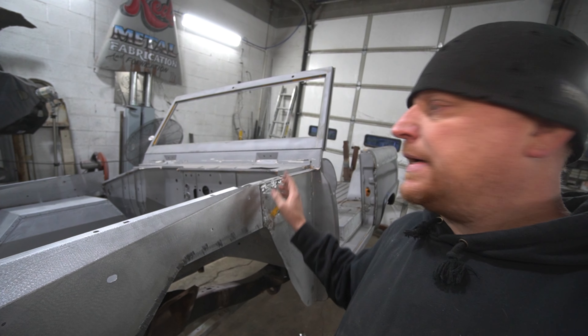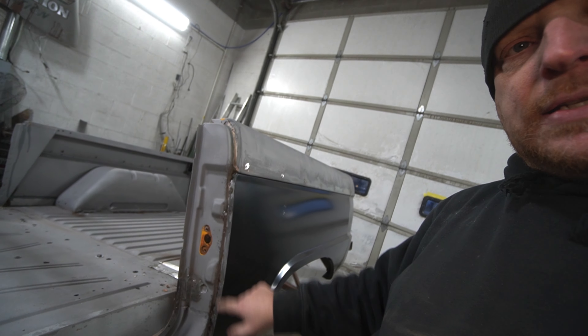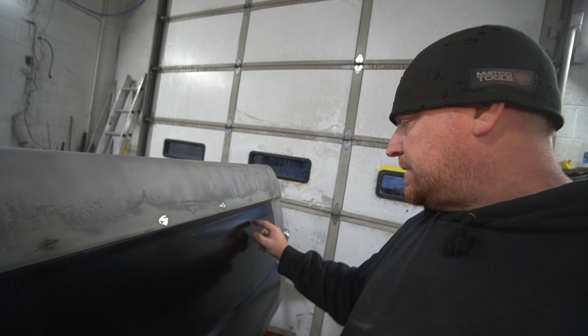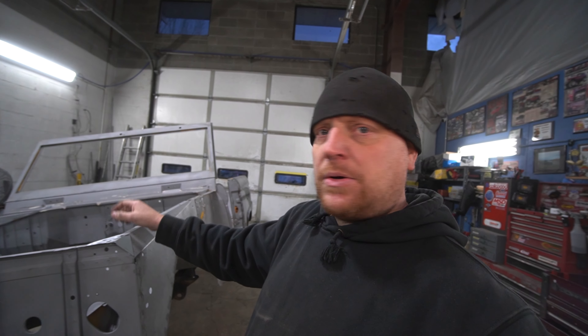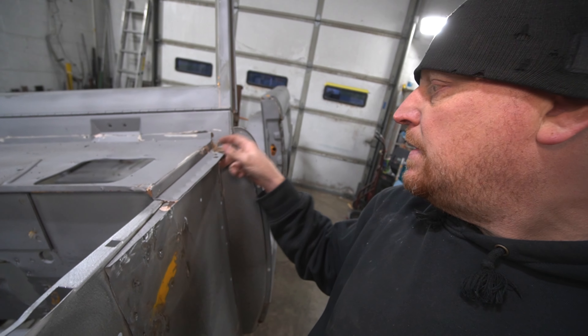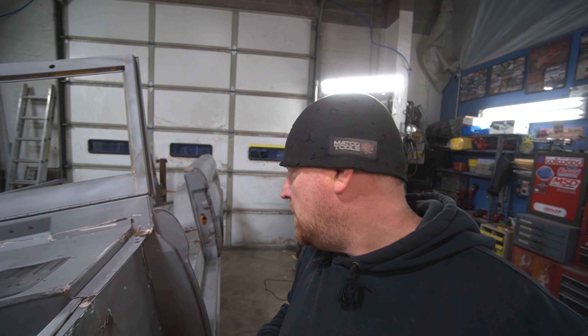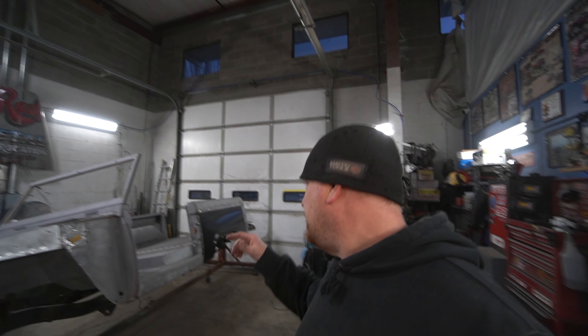Messing with the Bronco again - got everything welded on and kind of ground down. I gotta do a little hard stone grinding on the back corner. Got this cleaned up, it'll get seam sealed. We'll come back with 80-grit and knock the e-coat off - that's the stuff that comes from the factory when parts are made. We want to sand that down and use our epoxy on it to get a good grip, then I'm gonna do a couple more little weld spots and clean up some of the seam. Gotta open this up and get some of the sand blasted material out, then hopefully get it over to the booth and get it painted. I'll grab a DA with some 80-grit and start buzzing this thing down.